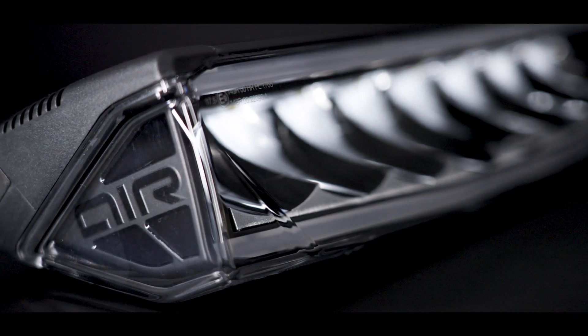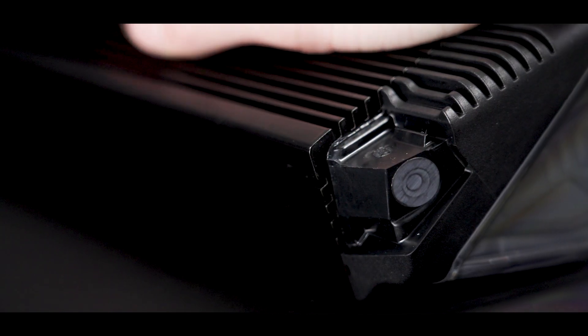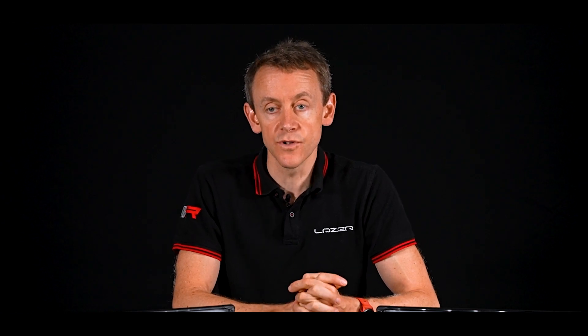The Air 90 lamp has two output modes: a low output mode and a high output mode. The low output mode is compliant with UNECE regulations and the lamp runs at an ECE reference of 17.5. To engage the low output mode, the customer needs to remove the supplied boost cap and add the second boost cap included in the pack — that second cap doesn't have a magnet inside, and with it attached the lamp runs in low output mode. So if you're driving between Norway and Sweden, for example, you can switch out the boost caps to ensure compliance with the necessary laws in each country.